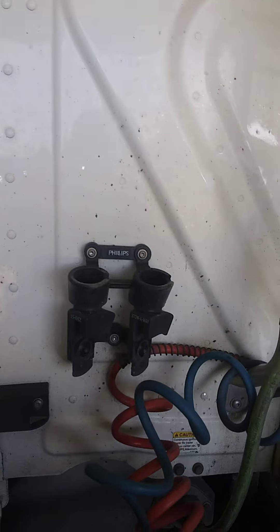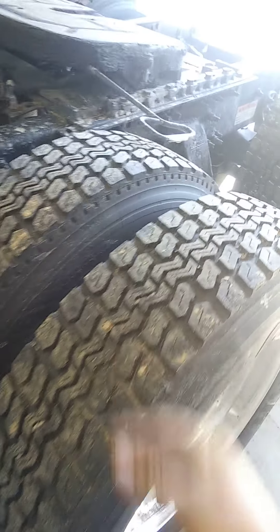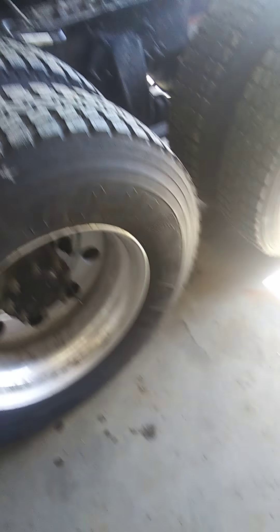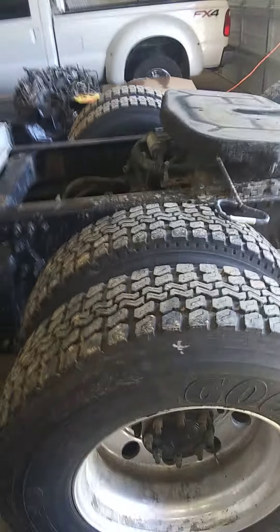Check your airlines — make sure they're not going to drag in the driveline area once they get hooked up. Your tires: some places will have a checklist from front to back, including how much tread each tire has and how much air. You'll need to get each tire to 95 to 100 pounds, no more than 110. Remember, heat will expand the air — if you put in 100, once they're running down the highway it'll expand to 110. So don't go less than 95 or more than 110.